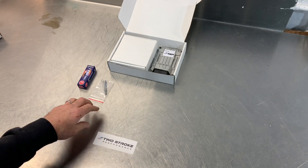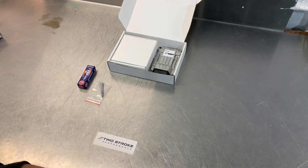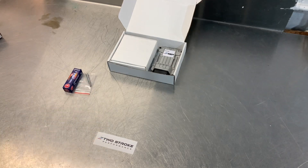I won't explain it all now, but this bolt allows you to set the idle speed. Most bikes don't require you to fit that bolt, but we include it anyway because it's simple, and if you're one of the small number of bikes that does need a change to the idle speed after setting up this power kit, then at least you've got it there and it makes it a bit more convenient.